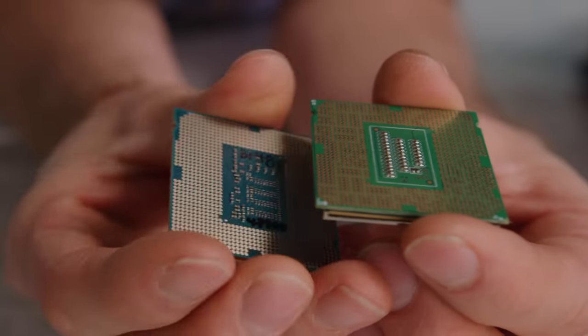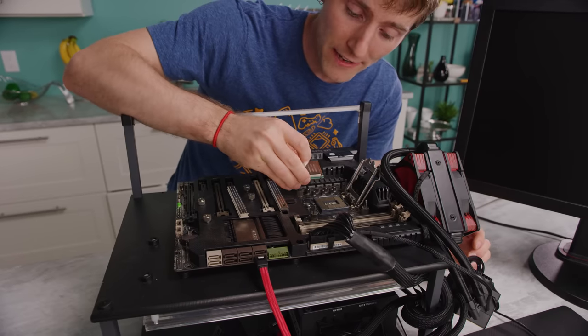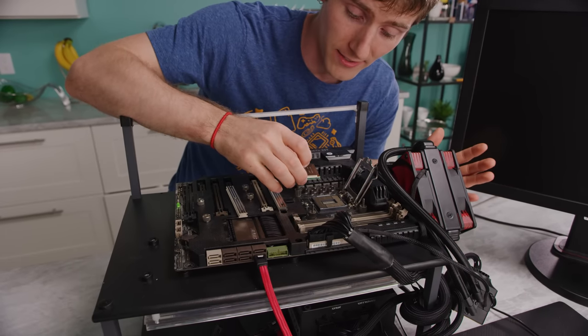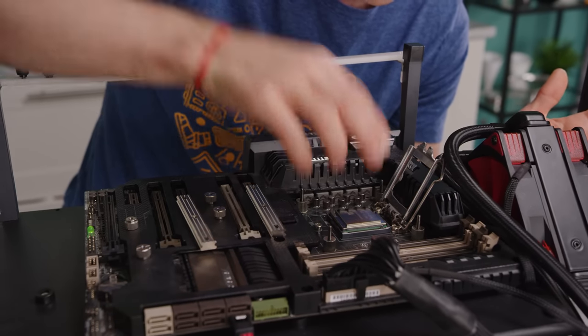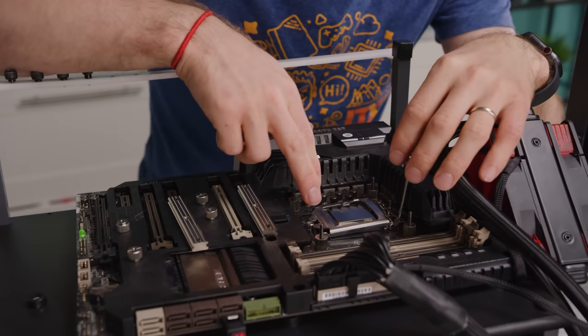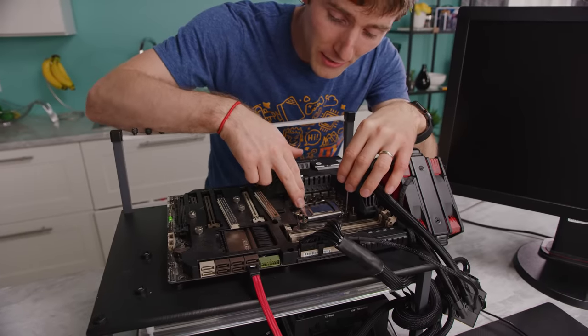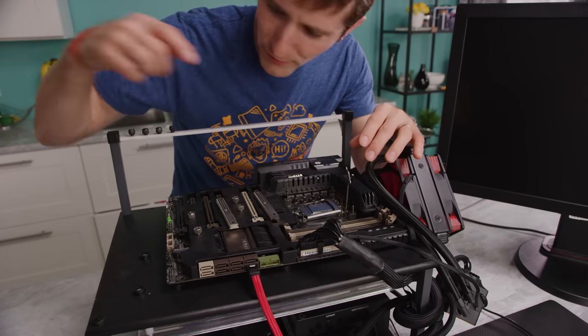Which is especially weird because the mobile versions of these fourth-generation processors actually had more pins on the bottom than the desktop ones. So how do you map more to less? How do you find a board that it'll work in? You guess. The manufacturer does list compatible chipsets — Z87, Z97, and the more mainstream versions of those couple of generations theoretically should work, but CPU compatibility from board to board is not always cut and dried. So we just grabbed the best Z87 board we had lying around. And oh boy, we're running up against our first hiccup.